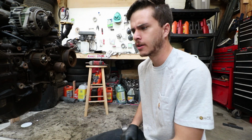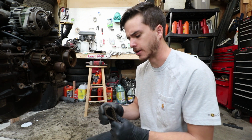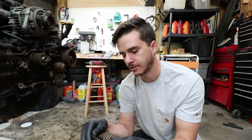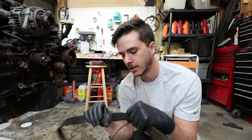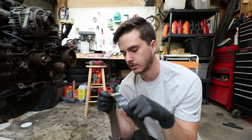So a few weeks ago I uploaded a video called Why You Need to Change Your Timing Belt on Time, something along those lines. I was working on a Subaru doing a timing belt. Actually, I was doing heads on it because the timing belt had failed. One of the idler pulleys had seized up and caused the valves to smash into the cylinders, so I had to install new heads on it. I was looking at the timing belt, and it was one of the worst ones I'd ever seen that hadn't itself failed, because the timing belt was still intact for the most part. But I'm doing this car, and this one is actually worse. So let's see.